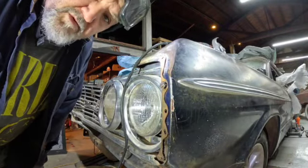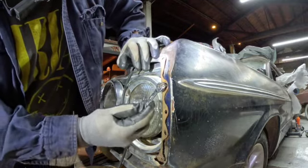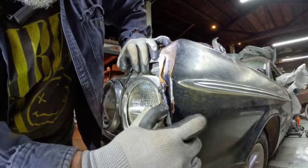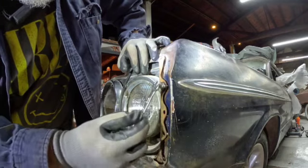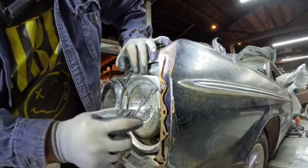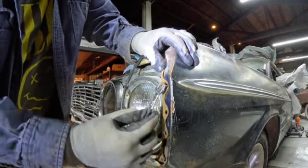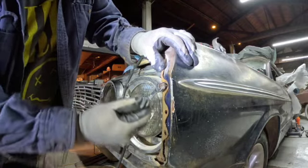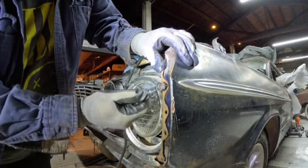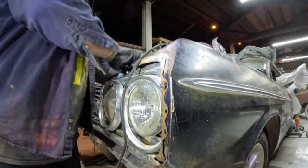Here, this is worth noting. On this one screw here, the way it feels is when I turn it so far, it feels like it's binding really hard. It's rusty on the inside end there, so the head's probably going to break off. After you've done some grinding on these heads, they get a little weak. So this is something you can judge for yourself when you're taking it apart: find a spot where it still turns relatively easily. In my case, I've got it out about 1/4 inch.